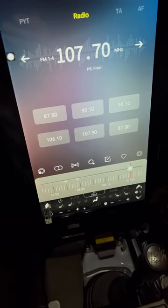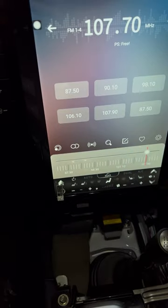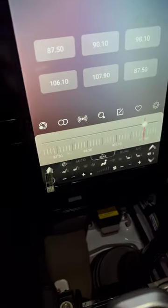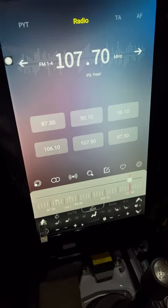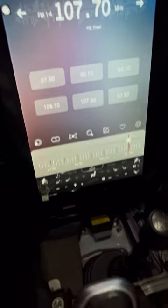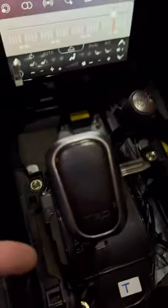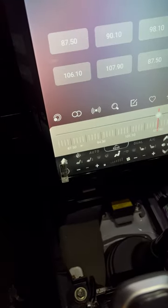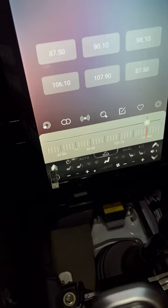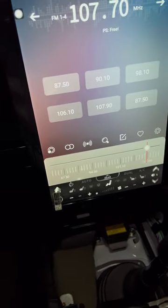Except I forgot to put in this piece on the top. I've got to take that off, two screws. And I can't get it to click in at the bottom. Well, I tell you, if you like playing with rat nests, whoo boy. First of all, you've got to put your car in 4 high and push this back. Otherwise, you don't have enough room. And you've got to run all the wires in the dashboard through the bottom hole, I think. That's the only way I could get any of the ones at the bottom to reach.